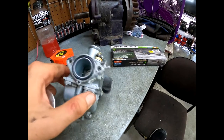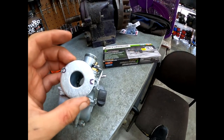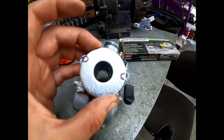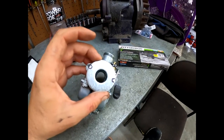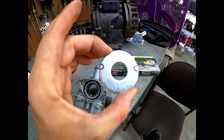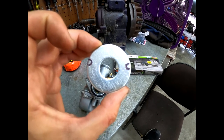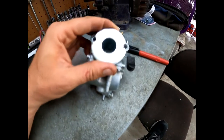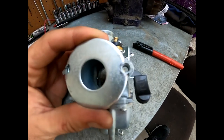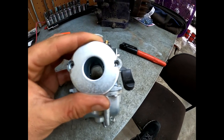So this is the hardest part here. I believe this is a knockoff brand 22-millimeter Mikuni. I'm worried about this because I'm not sure which carb he has. But every carb I've done like this, I've always had to put the holes on the very outside of the washer, and they hold — it's not a problem. I just hope I have them in the actual right place. The holes are a little off center to the top of the carburetor. I've got these holes marked here. You can either cut these out or drill them out — I'm going to drill them to make prettier holes. So I've got this piece now for the carb cutout, and it is very tight, but that's how I want these holes to be. I've never had a problem using the outside edges like this.